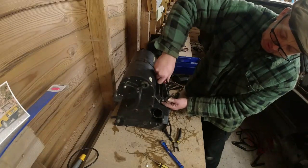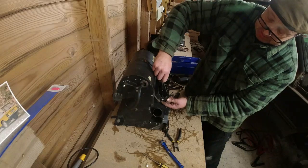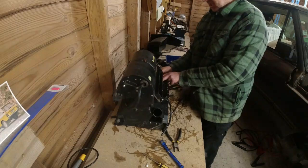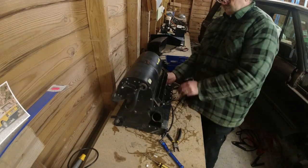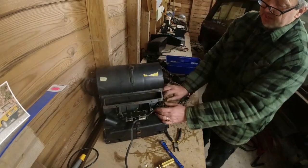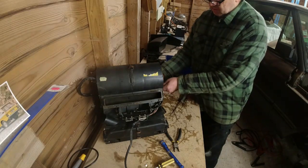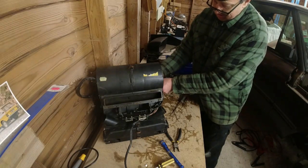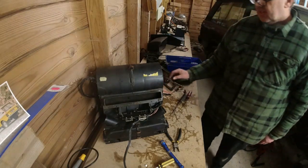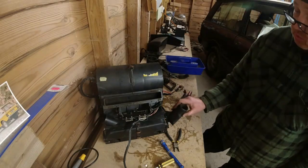One more electrical connection we need to do, and that's the vacuum switch for the fresh air at the back here. I'll show you how that one goes together. This loom, I just tuck it away behind the fascia vent loop there, plug it into the electric motor there, and that's the connector that goes into the main part of the loom. Okay, and that's that. Now I've got all these vents and things. These all need to go back on.